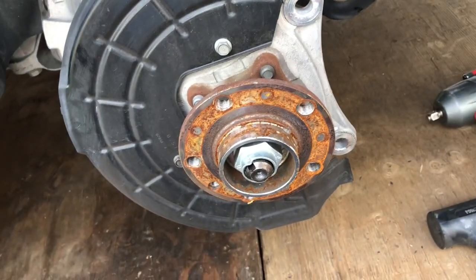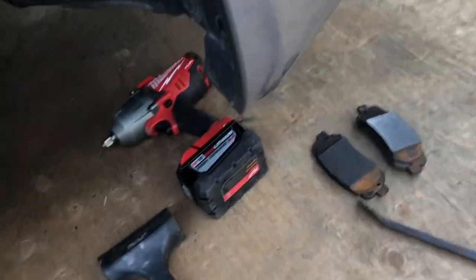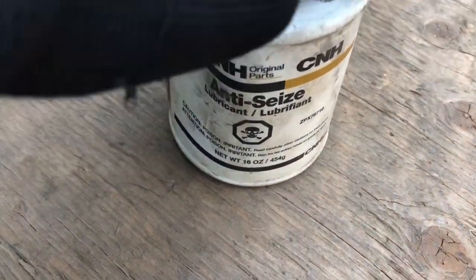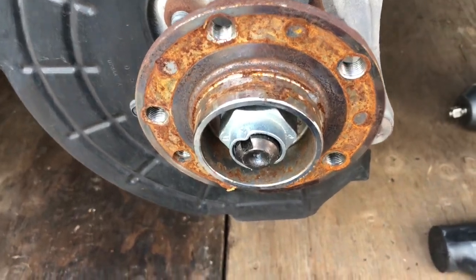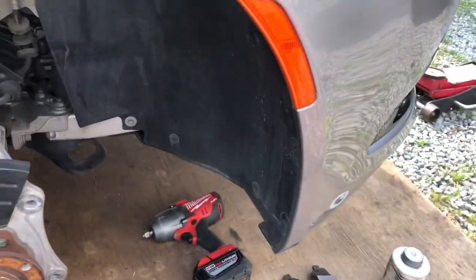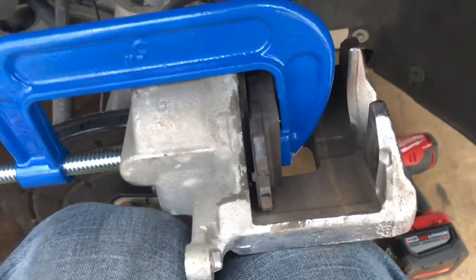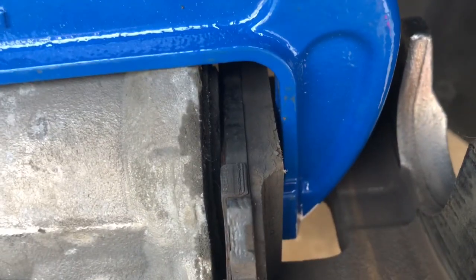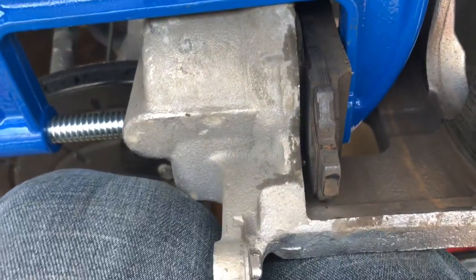Now that I'm at this point, I'm going to clean things up — clean that rust off the hub. I'm going to use a little bit of this anti-seize on the hub itself and that'll keep things from rusting, or at least not as fast as it normally would. The final step before putting everything back together is to take a C-clamp — a pretty big one, this is a five-inch one — and take one of the old pads, place it between your piston and the C-clamp itself, and turn that C-clamp tight until your piston stops moving. Once that piston has stopped moving, you are good to put everything back together.